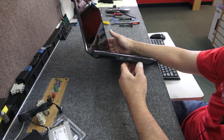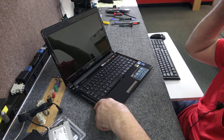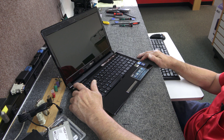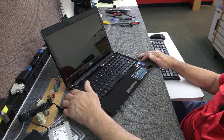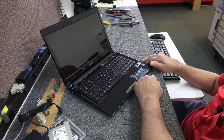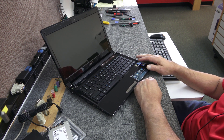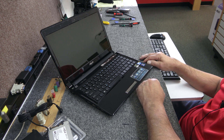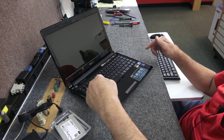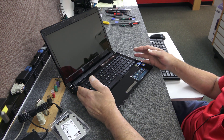That's kind of cool for the day. Back then this was a pretty expensive little laptop. It's got that old Express Gate ASUS BIOS OS that you used to be able to boot into, but that's pretty much long gone. When you look this up on the ASUS website, the newest drivers they have are for Windows 7. So I'm going to try to put Windows 10 on it and see if I can activate it using the Windows 7 product key so we don't have to buy Windows 10.